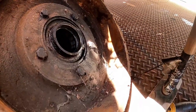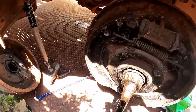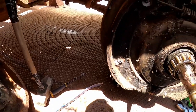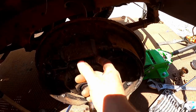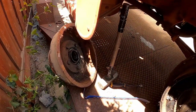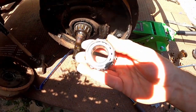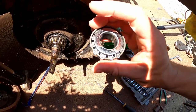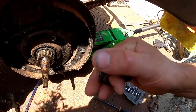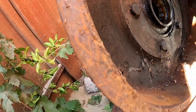Managed to pop the drum off and it looks like maybe it was just stuck because of rust formation on the inside of the drum itself. Everything else in here looks solid — the wheel bearings are okay, pads look like they actually have a lot of life left, and the little slave cylinder here doesn't look seized. I'm going to clean it up and get it to rotate. I managed to salvage the bearing that fell in the sand — a lot of dish soap, hot water, and water pressure got it completely clean, so I'll re-grease and reinstall it.